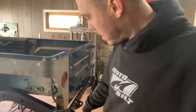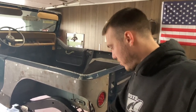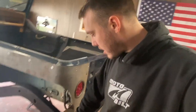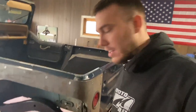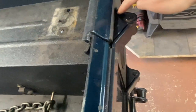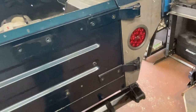A few things I think I'm going to address: this boxed in section where I cut it, I'm going to cut it back a little bit more so it's less protruding where the tire is going to be, just to prevent anything from rubbing. Then I'm going to take a piece of steel and cap that — that way it just cleans that up and doesn't allow junk, mud, dirt, and sand to get in there. One last look at the hinge spacers fully installed — it makes our hinge fully parallel without any play, and the holes do have a little bit of adjustment to get your gate to fit properly.